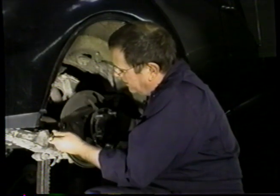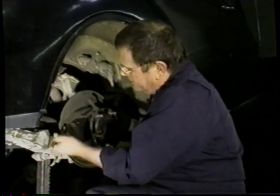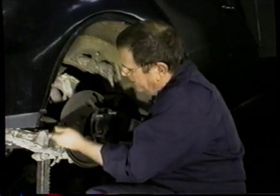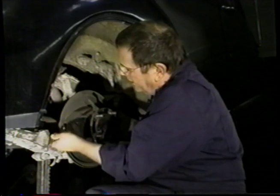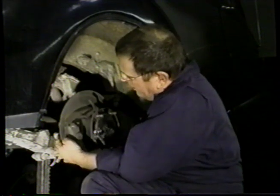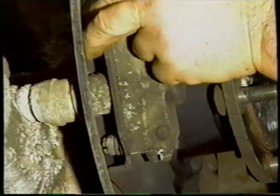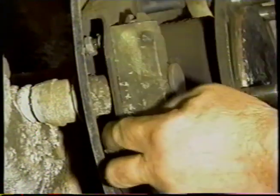We really need to get those slip pins, cotter pins out of there. If you really can't, and you turn the nut, you stand a chance of either pulling the stud out of the aluminum, which will cause you a good deal of grief because of the tight location and the fact that the rod runs right through, it won't release it. So it's very, very important. And those long handled pliers seem to be the ticket for being able to get the tightest of them. So we've now removed the nut more or less from the stud, and we'll leave those there.